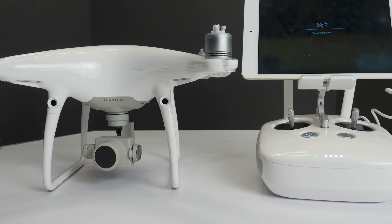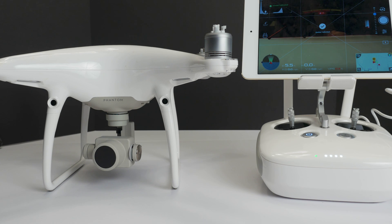One of the suggestions for centering the gimbal is to power off the gimbal, rotate it against the direction that it is facing until you meet a little bit of resistance, turn the power back on, then turn it off, and do the same function a couple of times. It should straighten out, according to the DJI administrator in the forums.